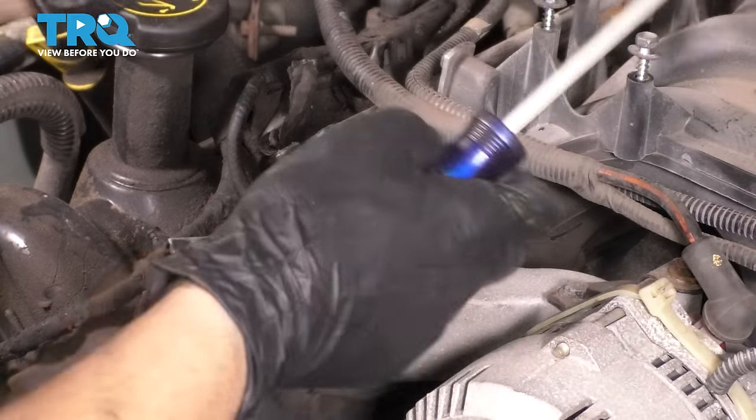Second pass complete. The head is torqued. At this point, you don't want to touch the head bolts anymore. Leave them as is. They should all be perfectly tight. At this point, let's do the same thing to the passenger side head, and let me show you that trick with the head bolt that I was mentioning. It's kind of the same as taking it out, just in reverse.